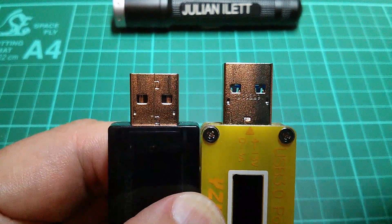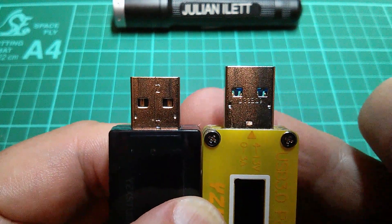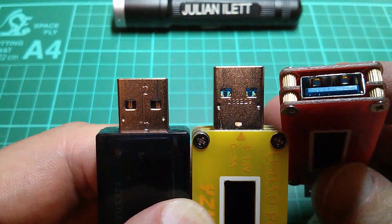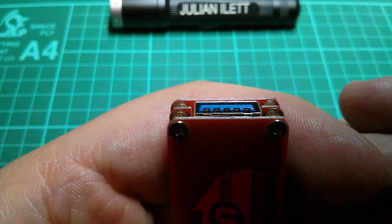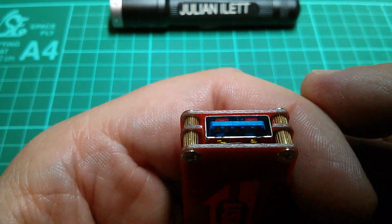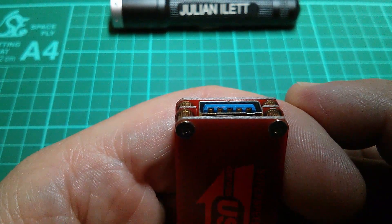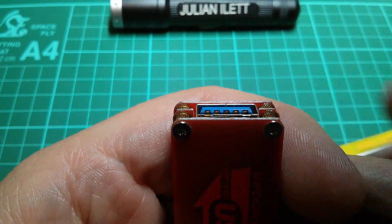It is pretty noticeable that the USB 3 plug is a longer plug. The USB 2 plug is a shorter plug, and the corresponding socket has a bit more depth for USB 3 than the very low profile USB 2 sockets. I'm only looking at the hardware here — the physical plug and socket arrangement. Five strips there and four springy pins. How the USB 3 spec works in terms of data speeds and all that stuff is a whole different subject.